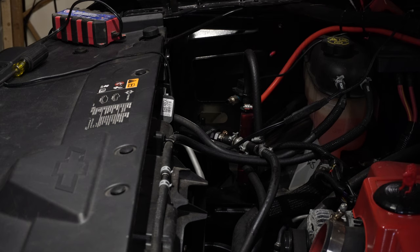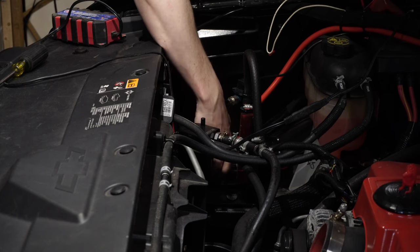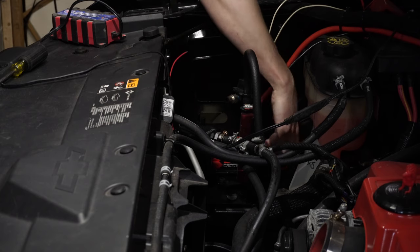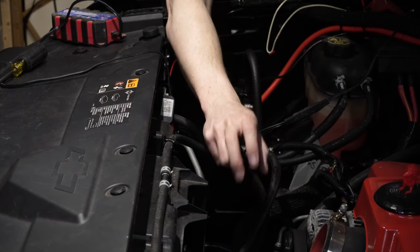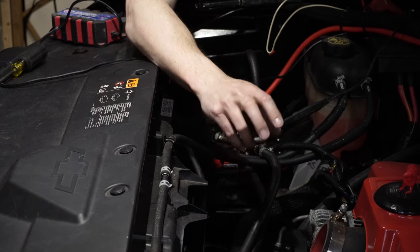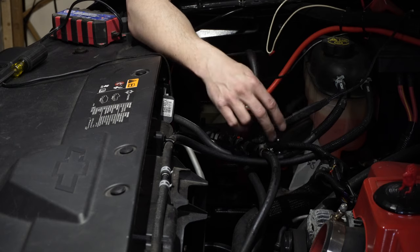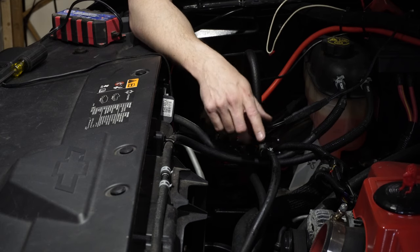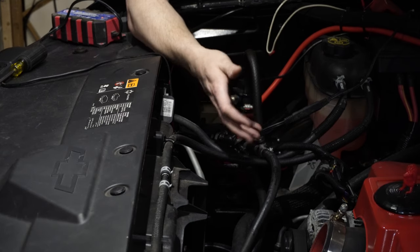We've got this nice battery tray down here that makes the perfect spot for mounting the methanol injection pump. I've got a couple of holes in here I can re-utilize. We can run the line from the trunk right up the frame rails and bring it up into the inlet on the pump side. Then we'll go out from the pump and have our nozzles right here on our inlet tube. The big thing about this is if you're running mass airflow with the temperature sensor built into it, make sure you get a breakout harness to separate the IAT out. You want to spray methanol or your methanol water mix after the MAF sensor but before the IAT, so we can see the drop in IATs going into the engine and run things like more timing.